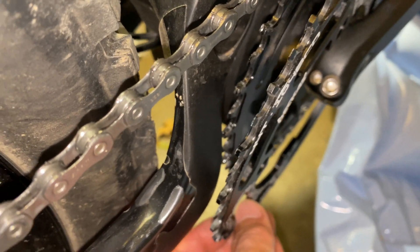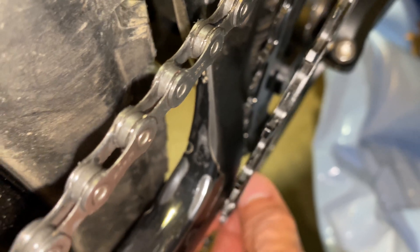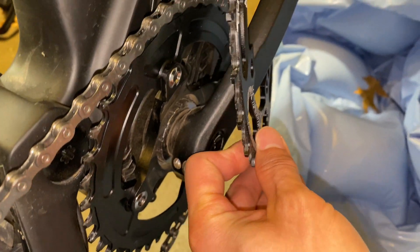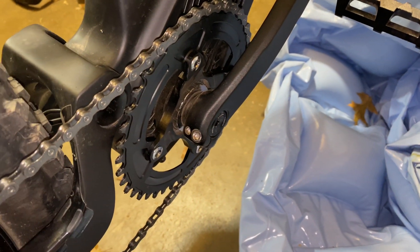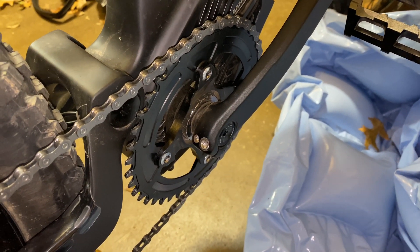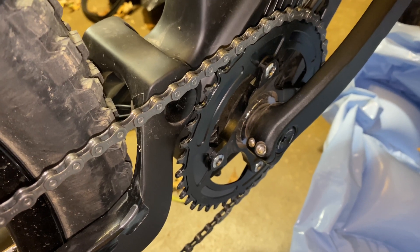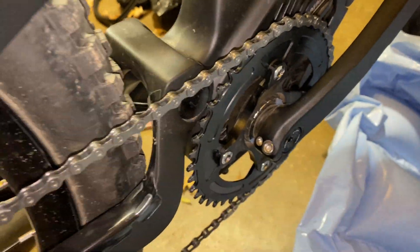What I'm thinking about trying is a 52 tooth. They make a 52 tooth with the 104 BCD spacing, so just out of curiosity I want to see what would happen if I put a 52 on there. That should make pedaling up to the highest speed really easy, and I'm curious what the real-world assisted speed would be using a 52 tooth. That might answer some questions for people interested in using this to commute and to go on the trails. You could actually mount a 52 on the outside and switch it manually by hand. However, you need to keep in mind the chain length, because you might not be able to use your 50 in the back if you're using the 52 up front.